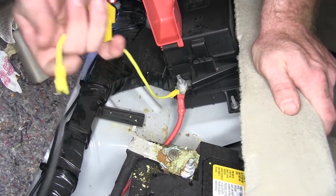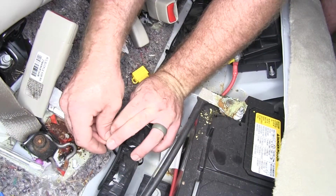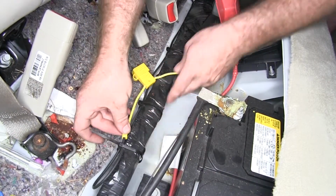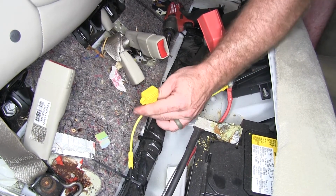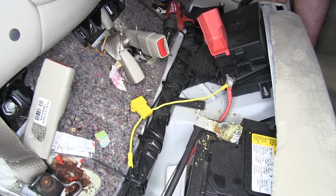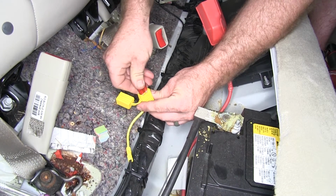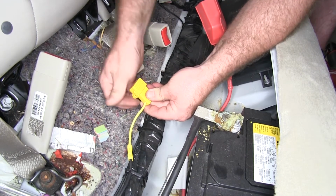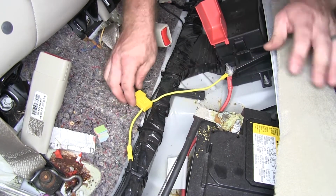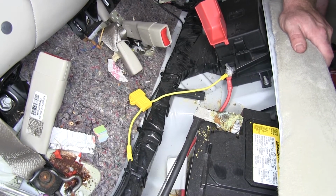So now I'll secure the excess wire that I've got here. Then I want to leave a little bit of play for that, so that if I need to get easy access to it, I can. Install the fuse into our fuse holder. We can put our cap over the top to help protect that fuse. Then we'll be ready to test our system.